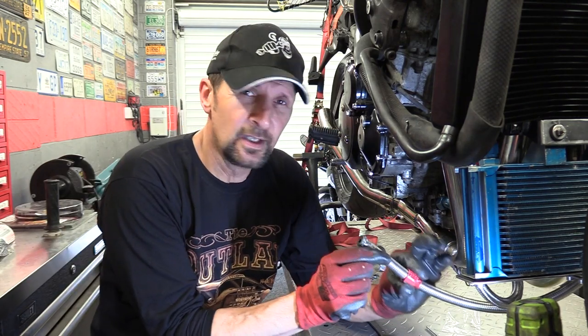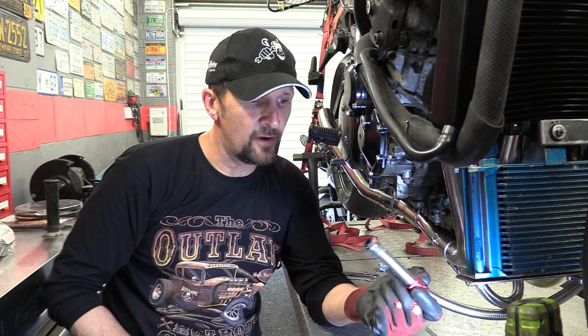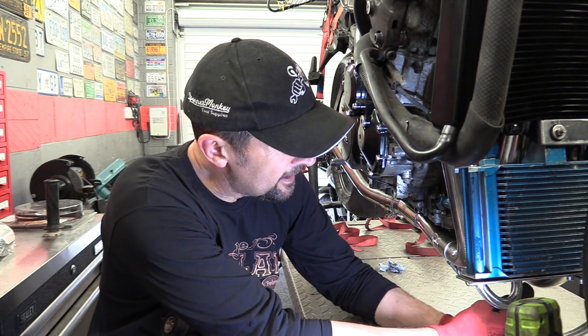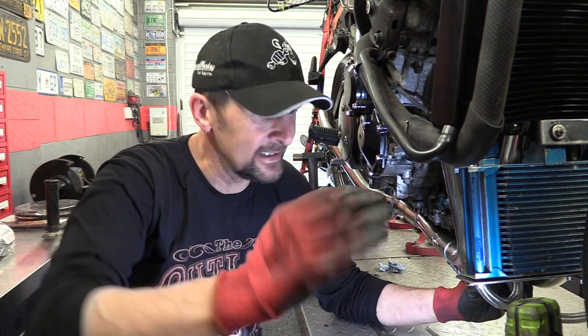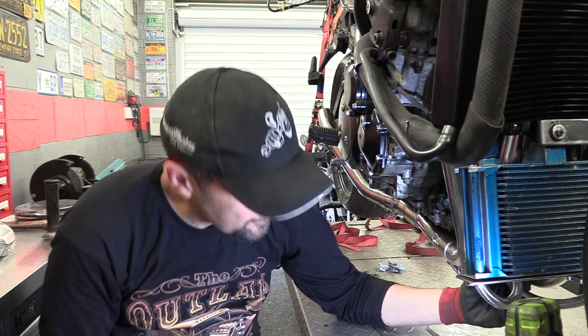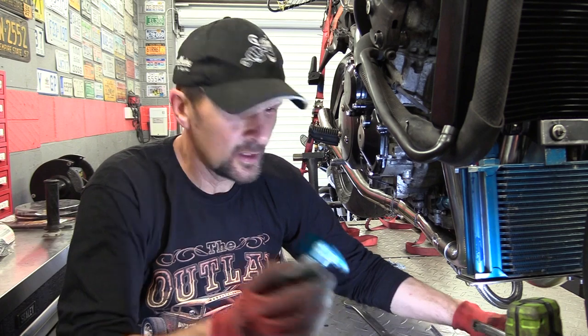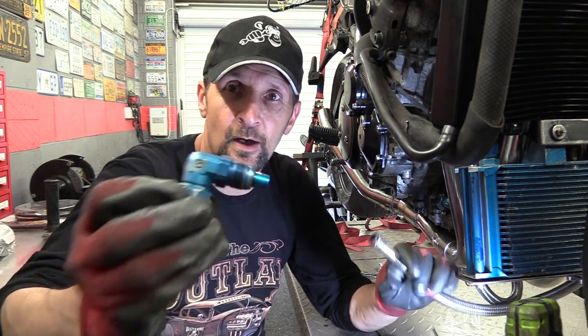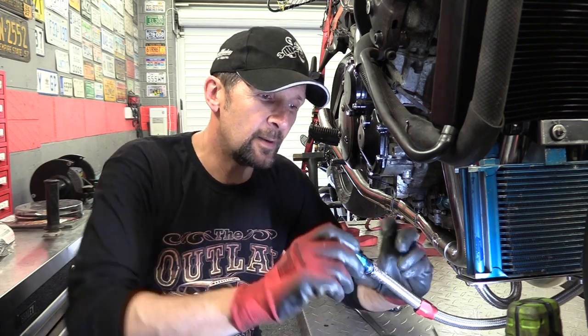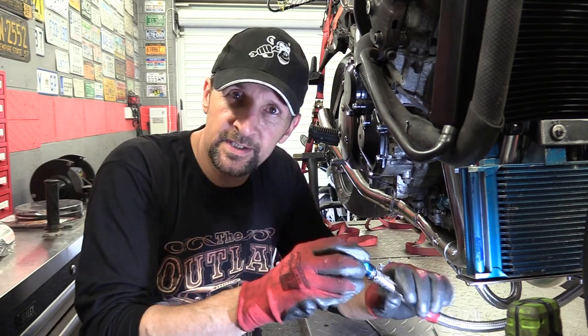Okay, that's pushed the collar bolt back, exposed about 4 or 4.5 inches of extra hose that I don't need. So just going to put it up in there, measure to what I think's right, so that when it's installed, there's nothing hanging down below the bottom of the exhaust pipes. Just going to bring it up to that point. And then when I've done, trim it off, and that just drops back in the hole, just like that. And then that collar comes up, mates together, and causes a nice seal.